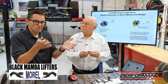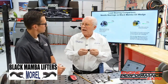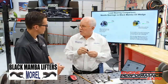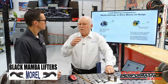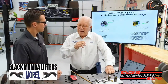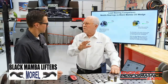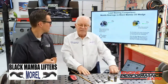In the event there was less oil available at startup and things like that — when we get a Cup lifter back for a rebuild, you can't tell that it was run. It is unbelievable how these teams keep the oil clean; they preheat it before starting. I do hear the question: what clearance do you recommend? People always have a friend at Cup, and they'll take one sentence out of a big system and say I'm going to do that. You have to be careful, because that is such a controlled environment — it's a complete recipe, and if you don't follow the whole recipe, you're not going to get the outcome.